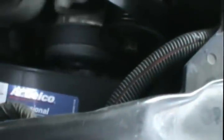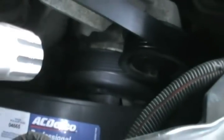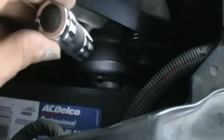Have a little oil pan to collect the coolant, otherwise it's just going to fall on the floor. Put the new pump in, put the screws back in the same holes, then put the belt back, lift that spring back up, re-bolt it, and you're done.